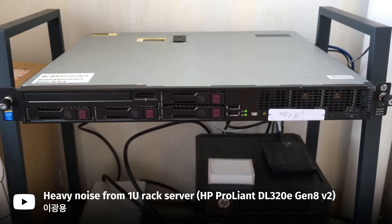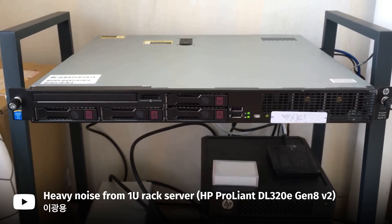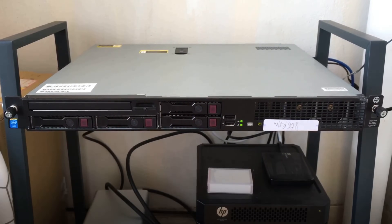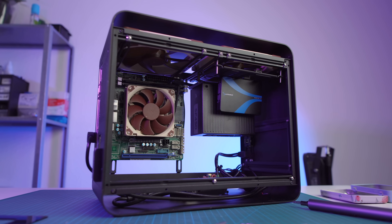It should be out in about a month if you're watching this the day it came out. First, let me tell you a bit about how I use my home server and what I need from it in terms of hardware and software. I need my server to be small and quiet, which eliminates both rack and ATX-style form factors. Rack cases often have industrial cooling fans optimized for maximum airflow with no consideration for noise, and ATX tower cases take too much space. So I decided to go with a Mini-ITX enclosure and motherboard. Even though you're limited to one PCIe expansion card on most Mini-ITX boards, that's not really a deal breaker for me.